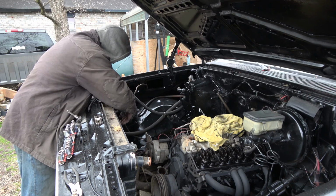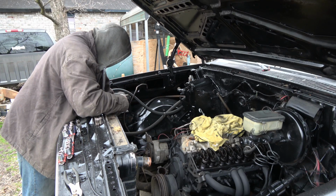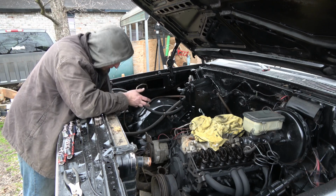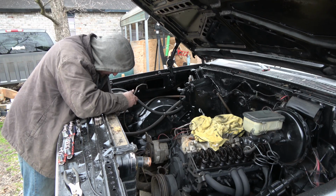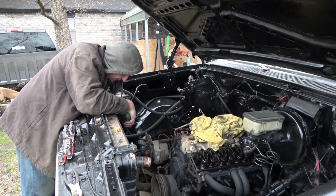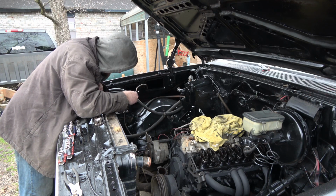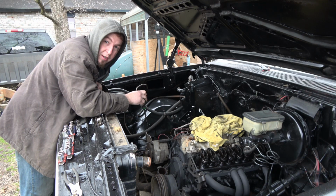And the one thing I am noticing, other than dropping tools, is that this transmission cooler, the way they have it plumbed, is not right. Now obviously they're running through the radiator, which is fine, that's factory, but they added an external. Well, on the external, they got it wrong. So, top's in, bottom's return. So top's hot, bottom's cool. Right now they have it from the hot side of the transmission to the external cooler, into the radiator, and then out to the transmission.